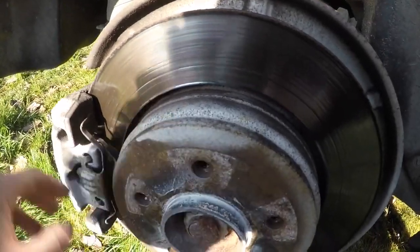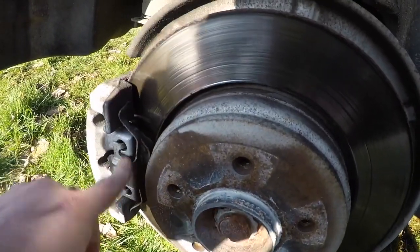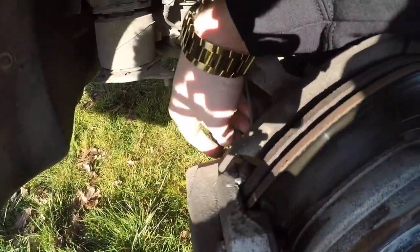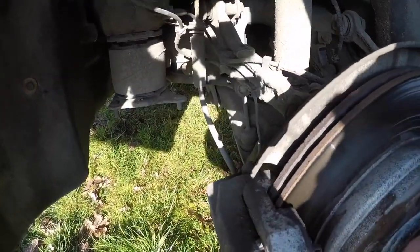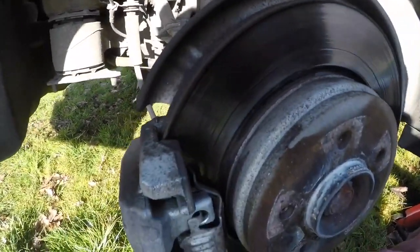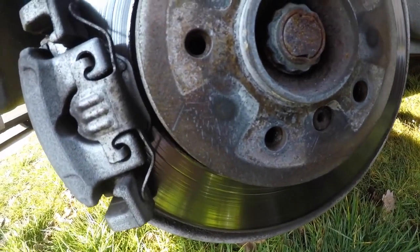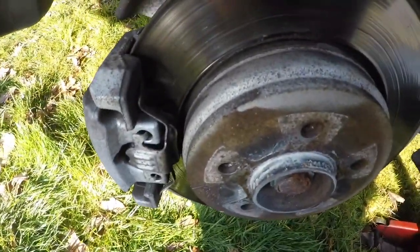The wheel is now off on the rear. We're going to remove the caliper — take off the circlip here that holds the brake pads and the caliper together so they don't rattle around. You're also going to take the bolts out the back, and disconnect the brake pad wear sensor running right here. After that's disconnected the caliper will come off. Push the brake pads in with a flathead screwdriver to loosen them, then undo the allen key nut to take the disc off. Once the disc is off you'll gain access to the brake pad shoes and we'll readjust them.